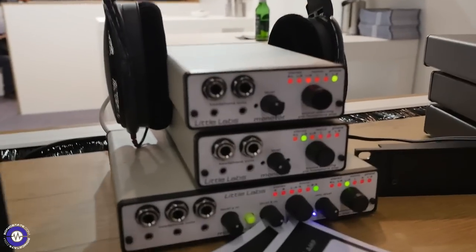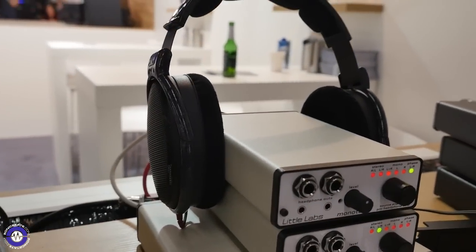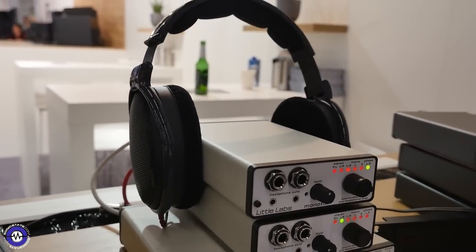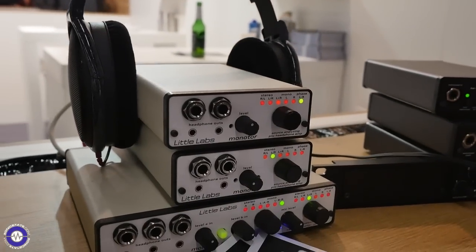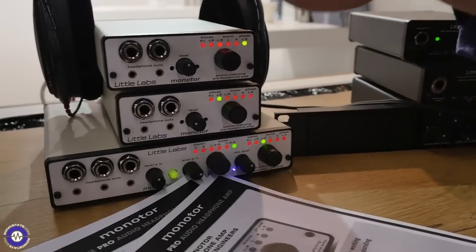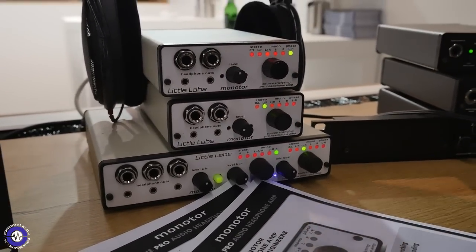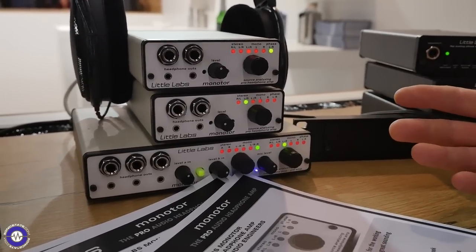Other things like John Bonham's squeaky kick drum pedal. You hear that on it clear as day. I highly recommend it with some of the better quality phones. I like it with the Sennheiser HD600s. They're my favorite. Now, a lot of headphone amps have a problem driving the HD600s because they have a higher impedance and they don't get up to the proper volume at that impedance. This easily drives an HD600, but it also drives the lower impedance, more common 32 ohm phones.